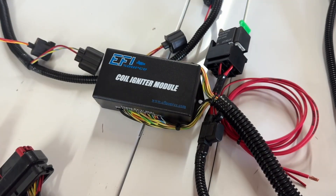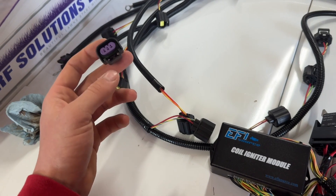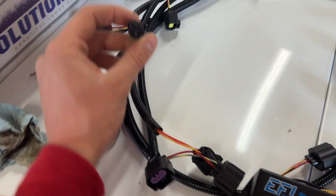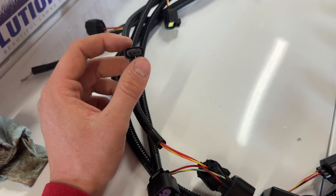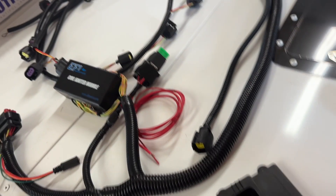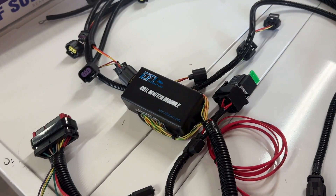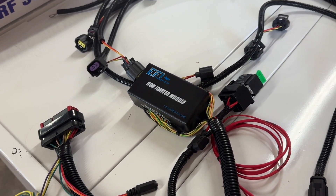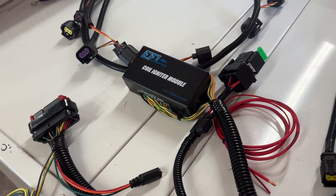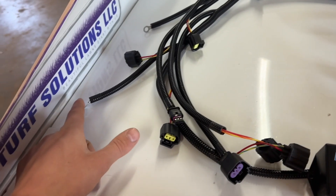Not sure why it doesn't do it directly — I'm not an electrical engineer. But this here is going to be your MAP sensor plug, purple three-pin. This little three-pin is going to be for your crank sensor, and your crank sensor part number is 514923088 — that's for an '09 to '12 Hemi. That's the one they tell you to use, so you should probably use it. These two are just grounds.